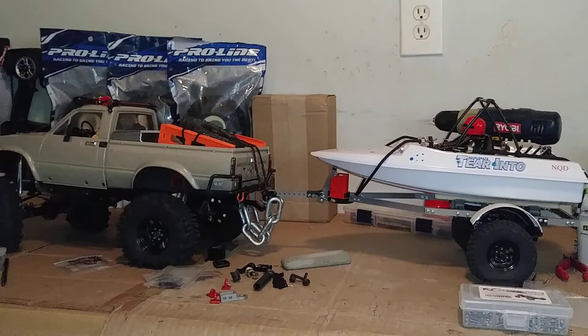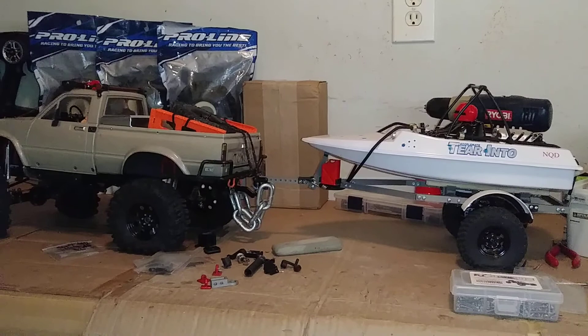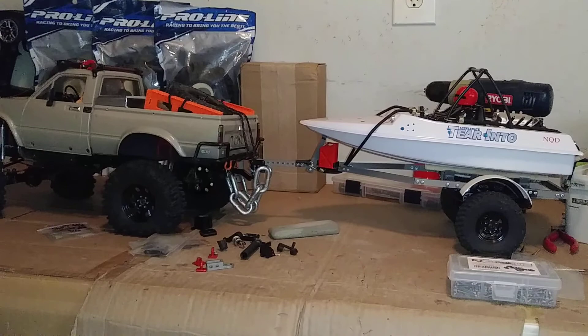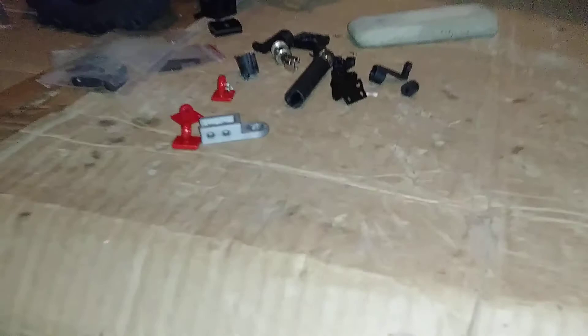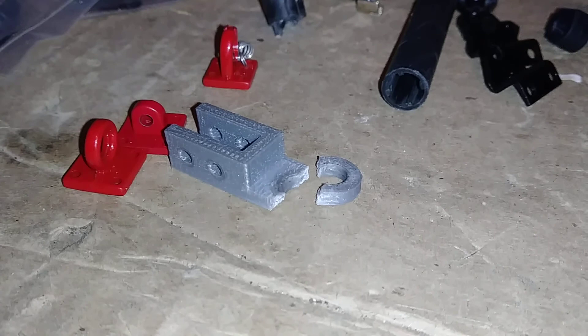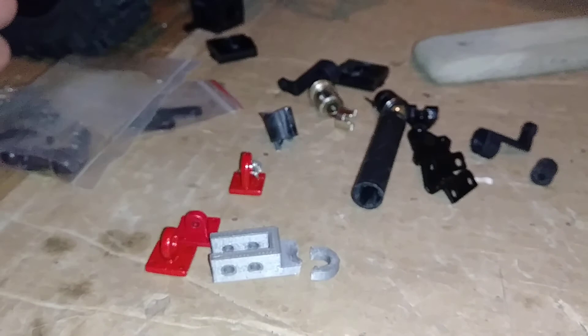We are looking at a big distraction here. Last time I took this trailer off-road doing a suspension test, after readjusting the shocks the suspension works great. But I had referenced in a previous video the 3D printed plastic hitch and wasn't too sure on the strength. Moral of the story: I broke the hitch on the way back to the parking lot on flat ground. It just couldn't hold up to the stress. Here's what's left of it — no real good way to glue that back together and have it be strong or stable.